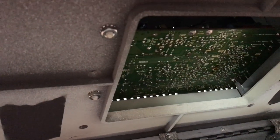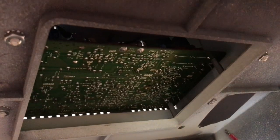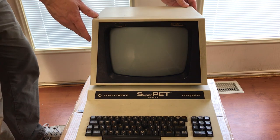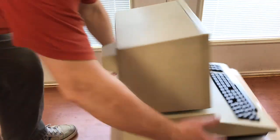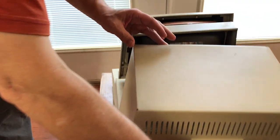You just have these four nuts here underneath the monitor that hold the monitor to the base. And this cable here just runs up through the opening there and connects to the monitor PCB. I can tell from looking at the front of the screen that we didn't have a break on the neck, but I'll open it up here anyway and see what it looks like inside.